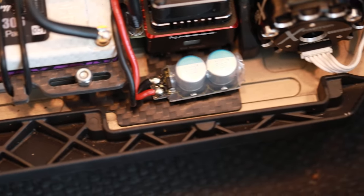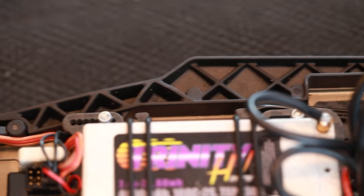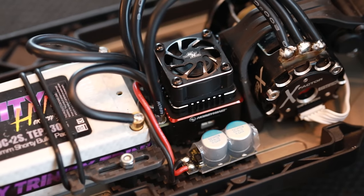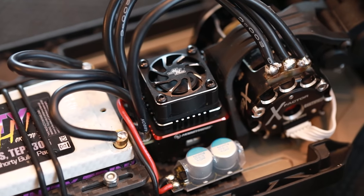Full disclosure — the ESC is now mounted behind the battery. It seems like that's really the only place you could mount it with this battery cradle system installed. I apologize that my wires are super long and wonky looking, but I really didn't want to cut them short because if I go to an outdoor track and want to go back to the stand-up transmission, it's much easier to leave the excess wire so it's always an option. Right behind the ESC you have the lay-down transmission.